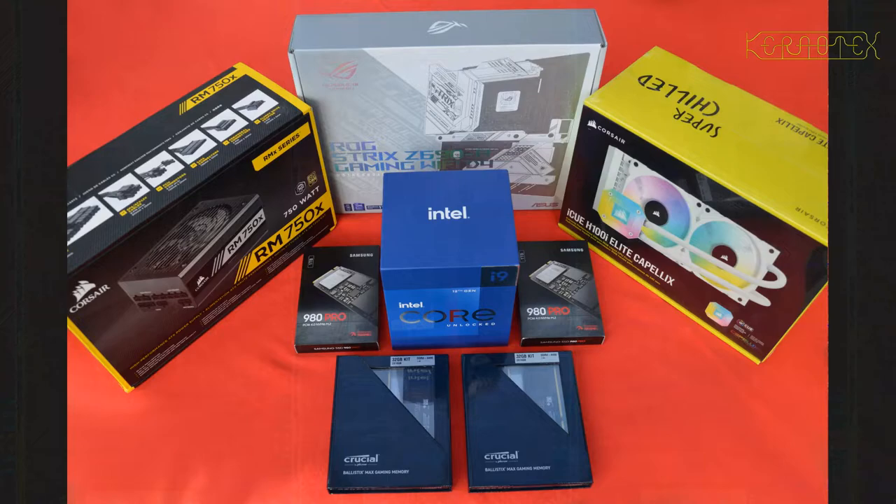I really would have loved to go for DDR5, but because it's so new it's extremely expensive and hard to come by in the capacity I wanted. It was either a case of finding 16GB DDR5 sticks at an absolutely expensive price, or what was reasonably priced was only 4GB or 8GB sticks, and I didn't really want to end up with just 32GB on the system.